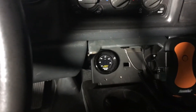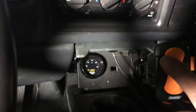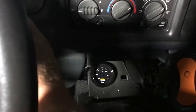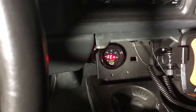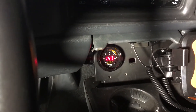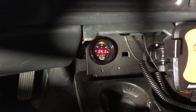There is the finished product for this wideband gauge. Got the interior back together, got my phone cradle remounted on the other side, got everything wired up, got that sensor plugged in. Let's start it up and see what happens. It's reading 14.7 — and now it's starting to change.